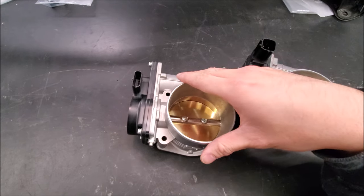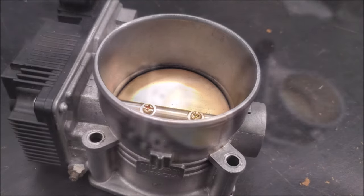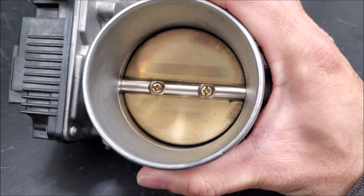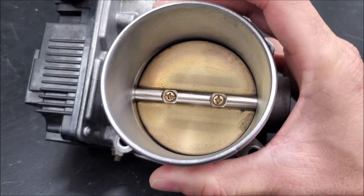Hopefully it's just going to let in more air and create more velocity, because it's probably going to act a little bit like a velocity stack. We can also argue that by upping the diameter of the throttle body from the original 70mm, it will help displace what the butterfly valve occupies.